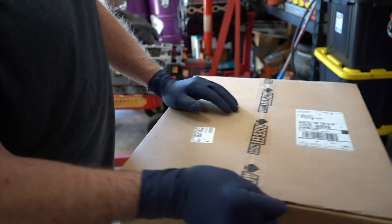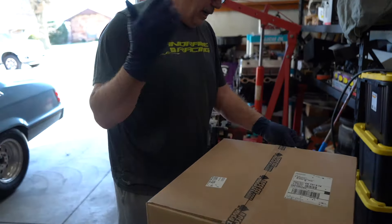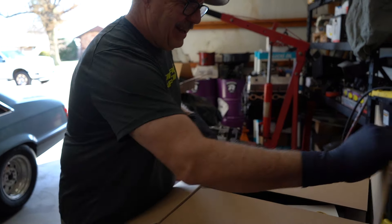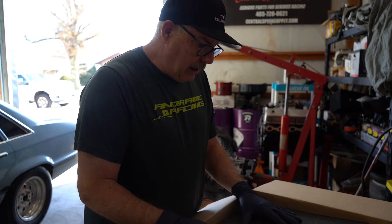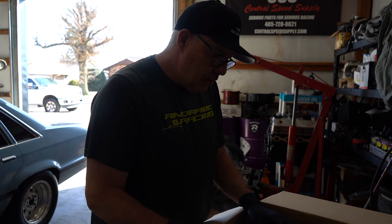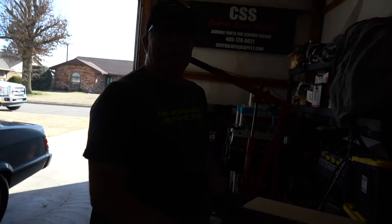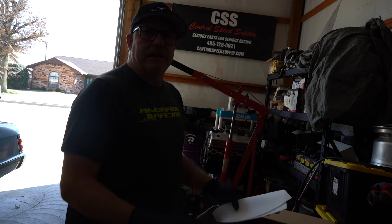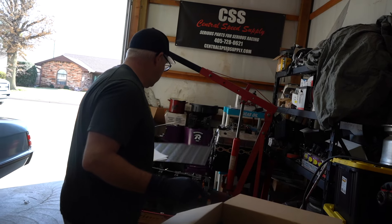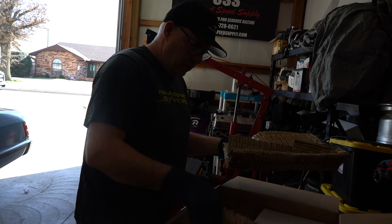This is our other box. Let's see what's in here. So we had the Jackpot Pro with trans controller. It shows everything we got. Seven-inch dash. EV6 36 pound-an-hour injectors — because that's really all we need on pump gas to make 500 or more. Especially if we're spraying a wet kit. This kit is good to about 550 with these injectors, and with upgraded injectors it's like 850 — that's what they said on the website.